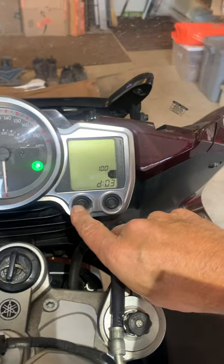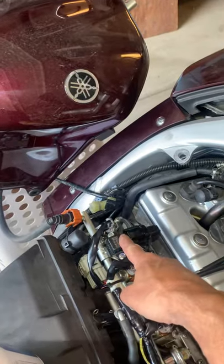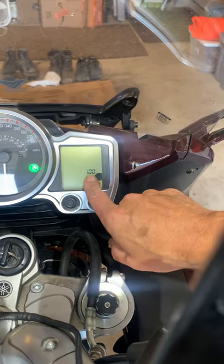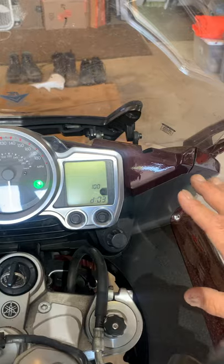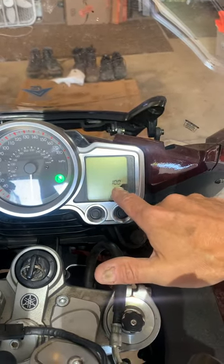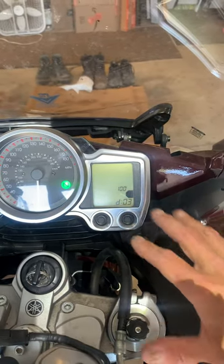Mine skips number two — I guess I don't have an atmospheric pressure sensor, which would be mode two. Mode three at 100 is this intake pressure sensor. I unplugged it and got 122. I put a vacuum gauge on it, sucked it down to about 10 inches of mercury vacuum and got 65. I don't know if that's right — I'd like somebody else to run this and tell me if they're at 100 sitting at sea level. Maybe somebody in Denver is at 85 or 90.